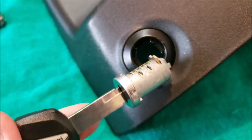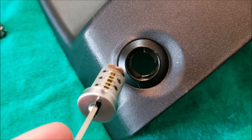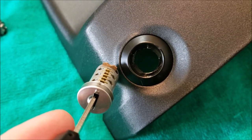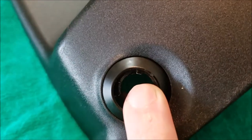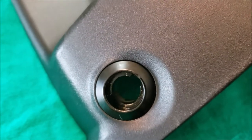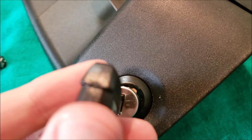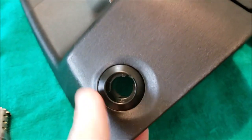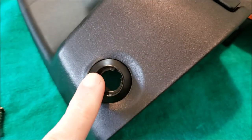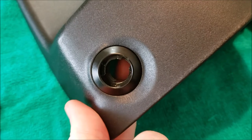To get the new cylinder in — here's the new cylinder keyed to my ignition key. You'll notice there's a little groove at the top of the locking pin and a little nub at the top of the lock cylinder. Work the groove against the nub, then press it in place to depress the lock cylinder, and twist and push it in place. Note that this piece can punch through if you put too much pressure on it, but it's just press-fit so you can replace it pretty easily.